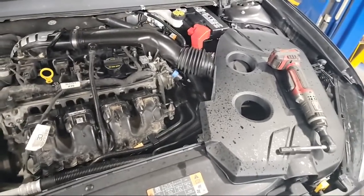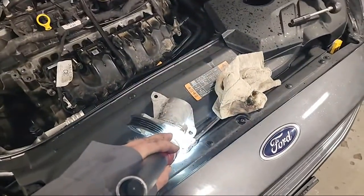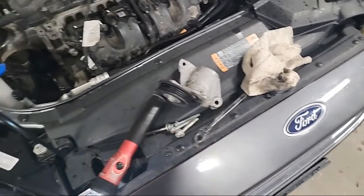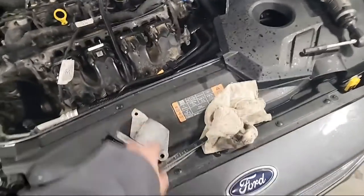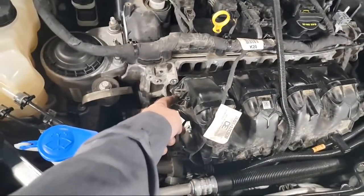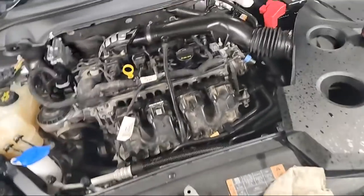I'm finishing up here. I dropped some CRC cleaner down these valves — I'll show you what they look like. On this belt tensioner there is a 14mm anchor spot for a wrench. I stuck the wrench on it, pulled it up, and pulled the belt off. Two 10mm bolts right here. Once I cleared the belt tensioner from the corner, I pulled the 10mm stud out, then there are 10mm bolts in each corner. Once all those come loose, you can look down inside each cylinder — I've got that CRC cleaner down in there, just soaking those valves right now.